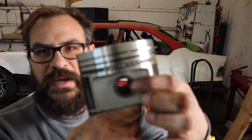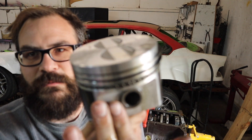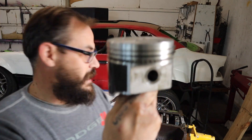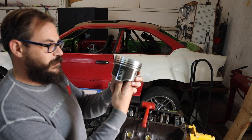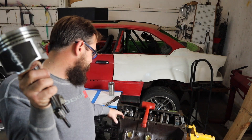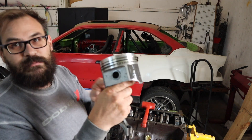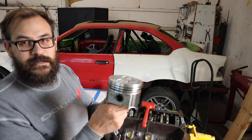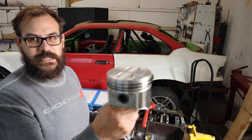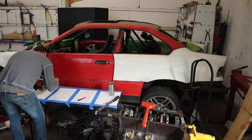You can see how this piston pin is offset — we've got about a two finger gap on one side and a finger and some on the other. We're going to take it from the number one side, put it on the number two side, and flip it around so the chamfer on the connecting rod matches up with the chamfer on the crank. That offsets the piston pin and leans it further into the crank, so you get work done sooner per compression stroke. Just ask Uncle Tony — those are my reasons and I'm sticking with them.